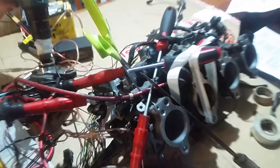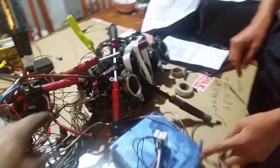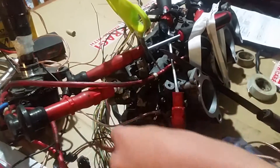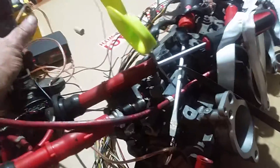So to wind everything up, it's pretty simple: once you've got power on these three wires and positive on the top right pin on the ECU, everything should work. And these brown wires all need to go to ground — brown is ground on Toyota.